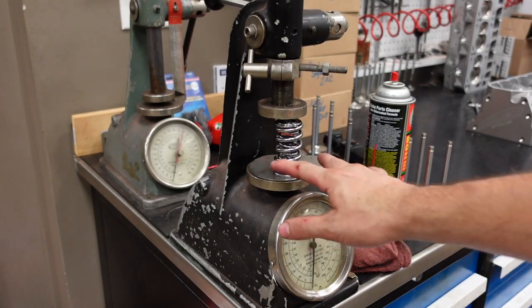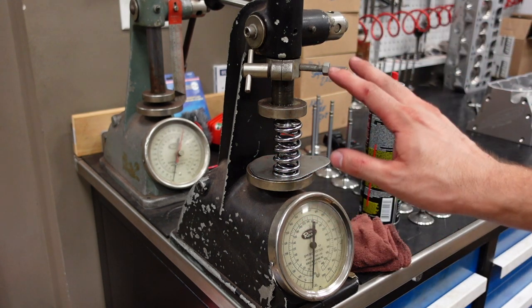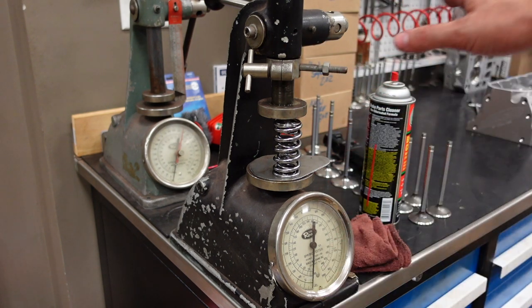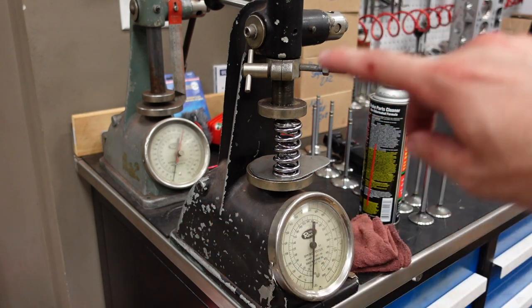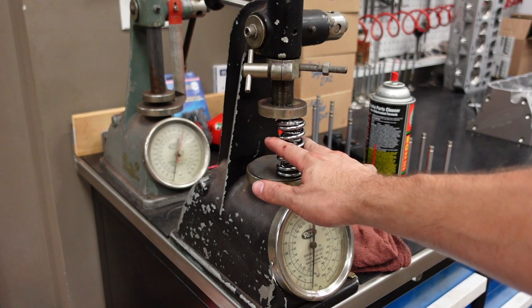I love the pressures that this spring is going to have with our cam. With these really lightweight valves it's more than enough pressure to control the RPM, especially with our cam lobe. There's a lot more to how much pressure you need than just the weight of the components and the RPM range — the cam itself, how gentle or aggressive the ramp up the cam is for the lifter really plays into how much pressure you need. That's the quick easy way I use to check valve spring coil bind clearance.